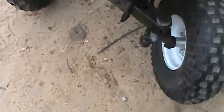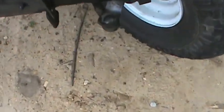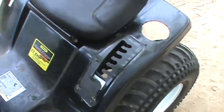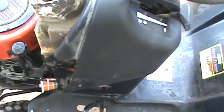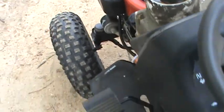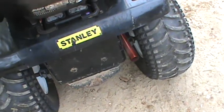There's still flop in the tie rods and tie rod ends — I'm going to have to change that out, and I found a place for them. I'm going to go with the same type of ball joint. This is five-eighths rod right here. I'm going to cut them back, weld a half-inch fine-threaded grade eight bolt to it, and then I'll have adjustable tie rod ends — at least on that end is all I think I need. I can pull that toe back in line. The bushings up front will need to be replaced — I have some brass, bronze, manganese, whatever they are, to replace those nylons. I do have some nylons on order anyway, because I'd have to do some modification to get the brass ones in there.